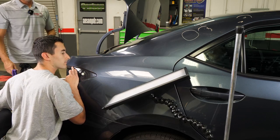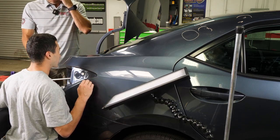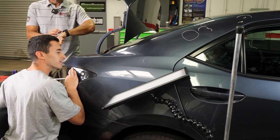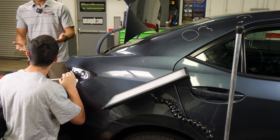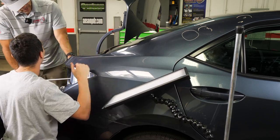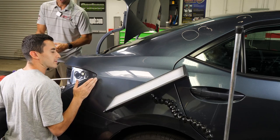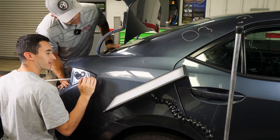You realize this is high-strength steel, right? Are you feeling the different parts of the panel — how it's different closer towards the body line? Yeah, a lot harder to push. Remember I was telling you: anywhere near a body line it gets tighter. When we start doing body lines next week we're really going to see that, and that's why you want flat bars and different things to help with leverage.